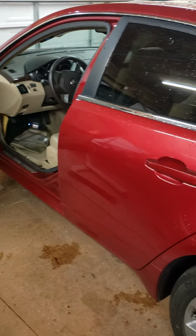Now, what I did notice was because I did know where the drain tube was basically on the inner fender well, the first thing I did when I came in the car was I took my hand and I pressed up against the carpet where the drain tube would be, which would be right up in here. I had zero moisture right there. I had water and it's still damp. The carpet is still wet. You can probably see it on my hand. So I've got to get that cleaned up. But she said when we drove the car last night that she thought she felt a drip on her left foot, which ultimately told me that water was coming higher than that drain tube.